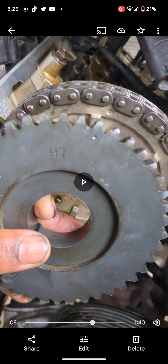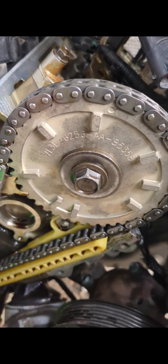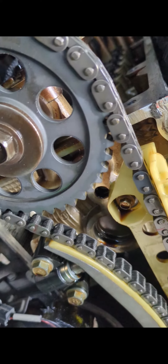This is something I could not have figured out unless I knew what the old one looked like. I ended up having to go to the factory and ordering new camshaft sprockets and new cam tensioners. Hopefully this helps you — always go with OEM and always pay attention to what you're taking off.